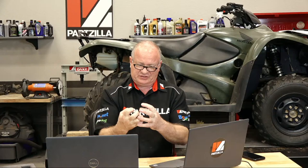Find out about the starter relay first and let me know, because good grief, if it's okay, all of those things combined makes me think you have a serious issue going on with your wiring harness. I mean, because it sounds like four or five wires are just burned together from what you're describing to me. So let's isolate the starter solenoid and then get back to us and let me know what you find.